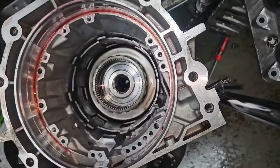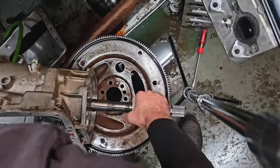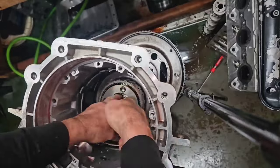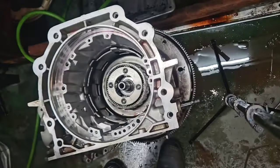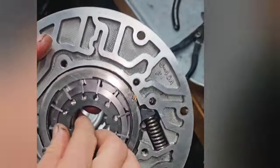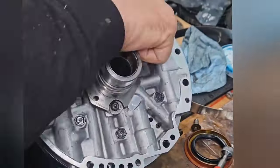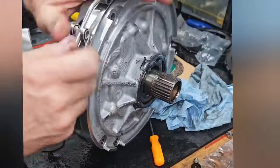And then I stepped up the torque converter a little bit, and I went with the converter that I use from B&I Torque Converter in Oklahoma, basically a Corvette converter. So it's a 2000 stall, just a tad bit higher stall, a little bit better of a unit. They built it nice for me. So I went ahead, did some upgrades on it, replaced the transmission cooler lines and everything.